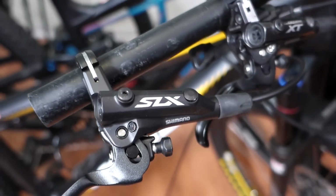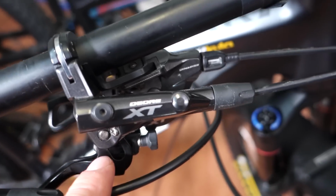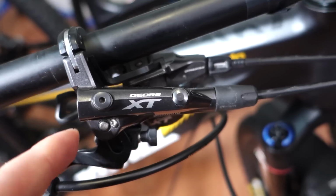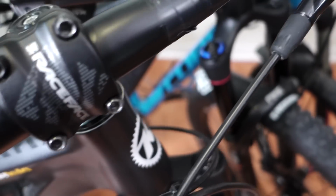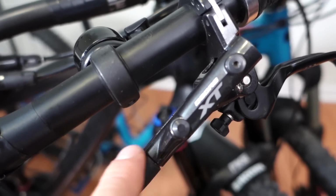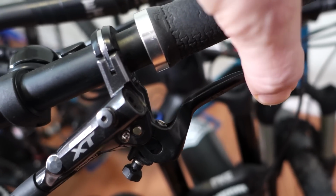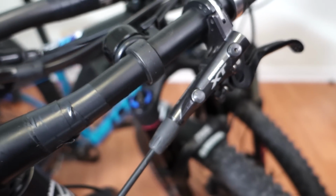If you stay with me this long, not only that you're an expert on the current Shimano brake portfolio, but you probably have some questions. And let me guess, one of the first questions is whether I had issues with the M8000 brakes, the XT. And the answer is yes, I did have some issues with the original or initial shipments of the XT M8000 that would provide an inconsistent bite point. So on the trail it would bite here, then it would bite further down, and that was the symptom. They replaced them, no questions asked.